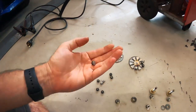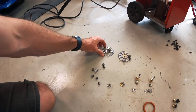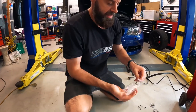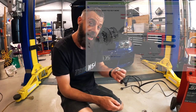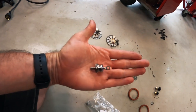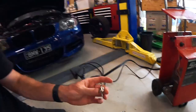So what do you do? You go online and find out what you can buy to fix these diodes. These button diodes are pretty old-school - keep in mind this battery charger is probably 20 years old - and I couldn't find any of them in the country at all. My original plan was to recut a piece of tin and get it working with the original ones, but I couldn't find the parts. So what I ended up getting from eBay were these new style diodes - I'll put a link below. It's much smaller than I thought; this is supposed to handle 50 amps. How is that supposed to handle 50 amps of current through that little thing? Anyway, this is what people are using to repair these old-school battery chargers now, so I'm gonna fit it in and see if we can get this thing outputting its original 60 amps. Fingers crossed.